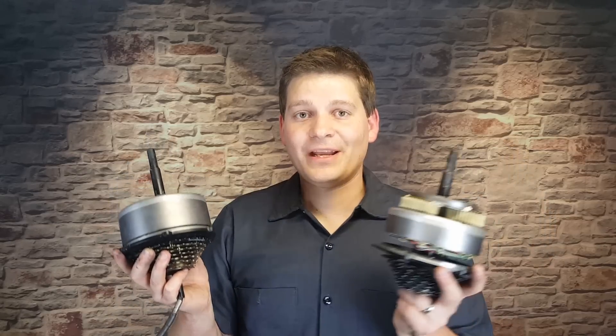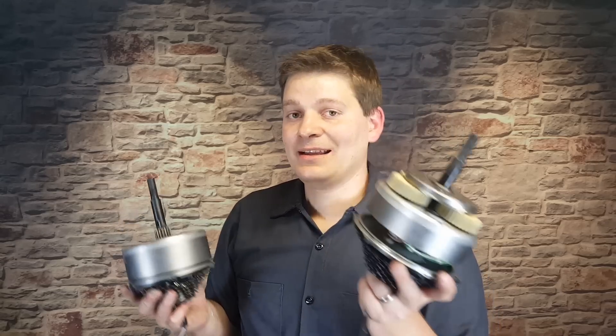I'm not going to get to it in this video, but I am having some parts made for the Rad Rover so we can change this motor and the controller that comes on the Rad bike to a larger motor and a more powerful controller. And then once we have those results, we can compare them to the stock bike. We can limit the power to around 750 watts after the upgrade, so we can pull the same amount of power and see if there's any difference in acceleration.